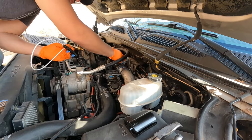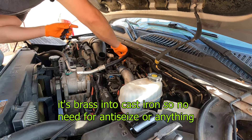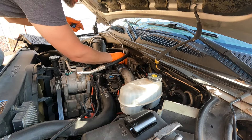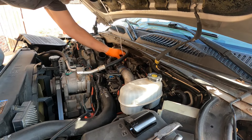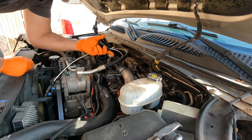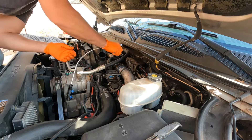When I took out the old vane sensor, I put a little something in there just to keep trash from falling inside the turbo. To reinstall, all you've got to do is screw it into the hole. One thing you want to do though — unlike when we took it out, you do not want this cord to get all tangled up. So leave the cord detached and twist it along with the sensor as you screw it in. You can screw it in all the way by hand until it gets tight, then take your special vane position sensor socket, slide it over the wire and down onto the sensor, and snug it up with a regular three-eighths ratchet.